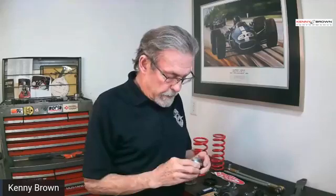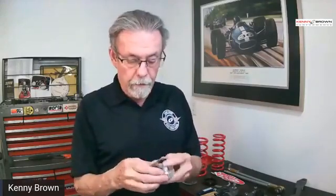diff bushing. Now, I went to put one of these together for you and discovered that we just sold out. We had a couple left on the shelf, and they went this week. I went to build some more, and we're out of the big washers. So you're going to have to use your imagination. In between these little washers, there's a big inch and 7/8 diameter washer. That creates some adjustability and a heat sink. So one value is you remove the rubber, which is soft, and replace it with something hard.